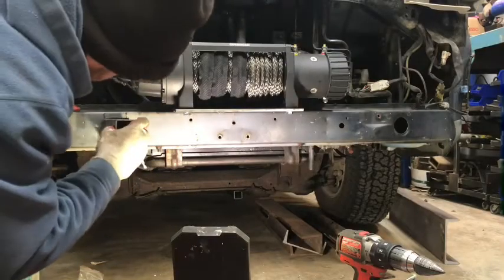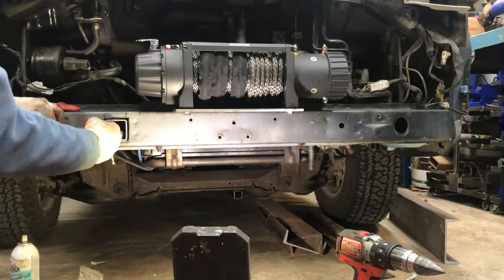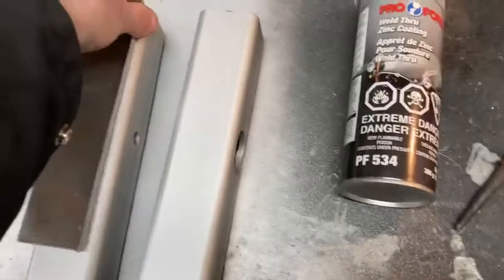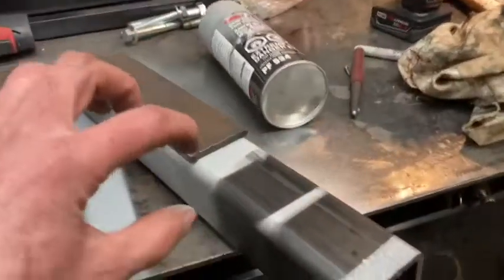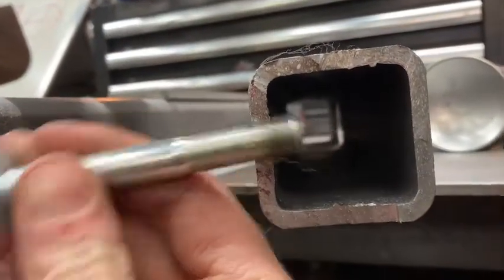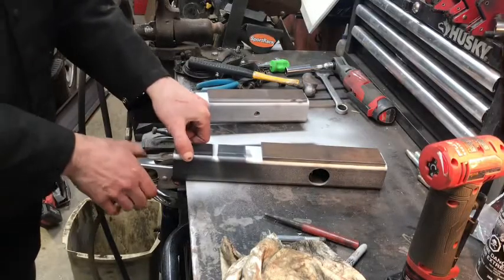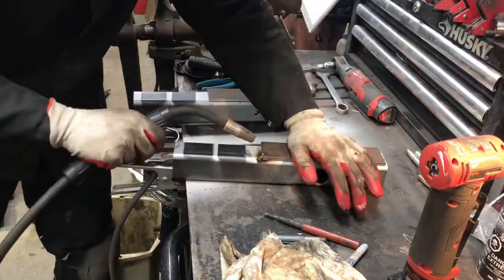The inside of the frame is two and a quarter inches — I was correct about that. I'm more worried about lateral side-to-side movement, so I'm just going to use some quarter-inch flat bar that I had kicking around. I've used zinc weld-through primer on that because it's going to be inside the tube and there's no way to paint it before welding. Laying those on there will fatten it up to two and a quarter inches. I've already drilled holes and mounted a nut inside — once the bolt is put in from the top it'll draw the whole thing up into the top part of the frame, and holes through the side will make everything solid. I'll tack them first to make sure everything fits, then weld permanently.